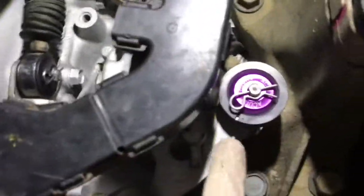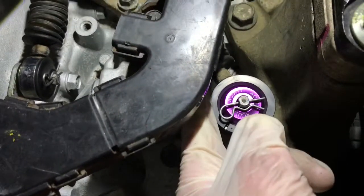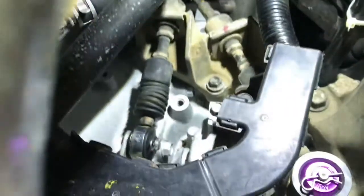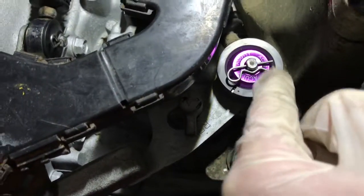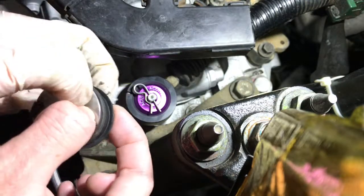This is a replacement and also an upgrade by going with the Acuity brand instead of just a stock replacement. After those have been swapped out, you get the new ones — it comes attached together, the little aluminum billet piece with the rubber bushing ring around it. You just pop it into the shifter arm by pushing it down. Make sure the shifting arm is facing the same direction and hasn't turned or twisted — you can mark it at the top with a highlighter or Sharpie just to make sure. After you push it in, there are two metal rings — basically washers — for each bushing. You put pressure at the bottom of the ring, push and hold, and then with your other hand push and twist.